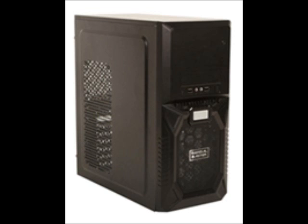For the case and power supply, we're going to be using a Cooler Master TC-102 mid-tower with a 500-watt power supply. This part's from Micro Center — it's the only part from there. It's a 500-watt power supply from Cooler Master, so you should be good. Side note: the 500-watt power supply does not have an 8-pin or 6-pin PCI-E power connector. So if you want to add a graphics card that needs that in the future — it does have a PCIe 2.0 lane — be aware the processor is going to be a bottleneck anyway. But it'll do fine for powering all your stuff.